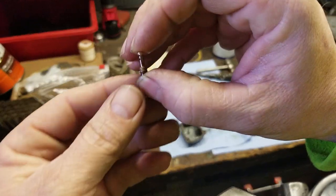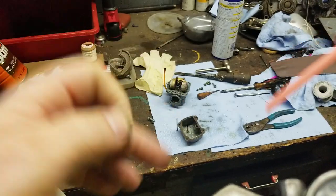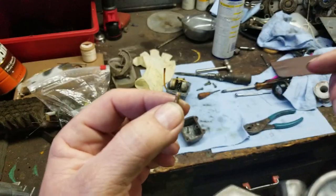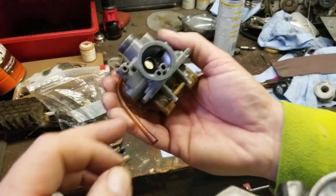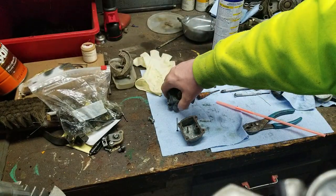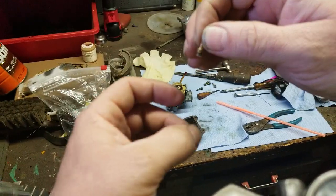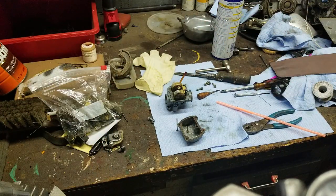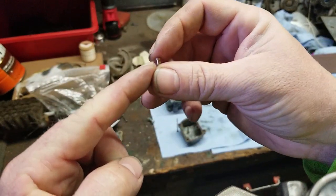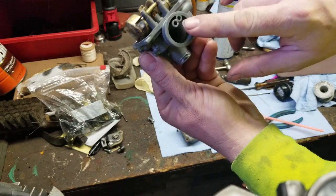So that is where this straw goes into play. It comes right up to there. It allows the air to come into the bowl and suck it up through. It creates the siphon effect. And the jets in the front of the carb, right here, are little jets. These ain't this big. If you look further into them, you can see how really small they are. They're really small air jets, and they are metered to allow a certain amount of air in to suck the fuel up for a siphon effect. So keep that in mind. These are very important, so make sure that all your holes along the sides are clear, and that your jets in the front are clear.